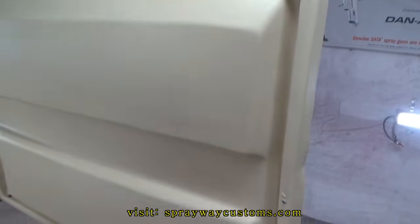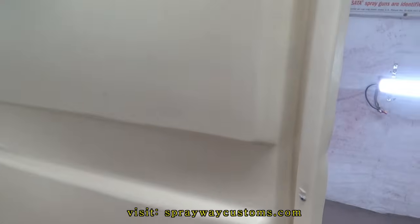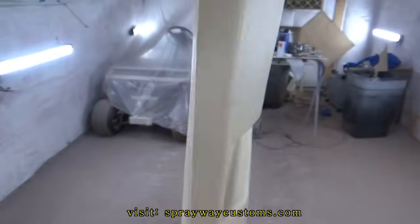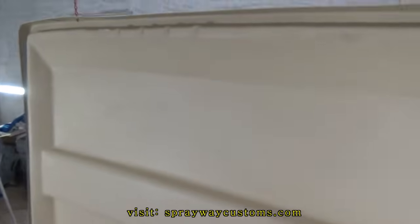Finished laying the plastic adhesion promoter. I'm gonna go with black. I'm gonna spray a black base coat, then I'm gonna put a flat clear on top of it. I don't want it shiny, I just want it flat, but I'm putting some protection on it by putting a flat clear on top of it. Let me go ahead and put that in the gun and spray it.